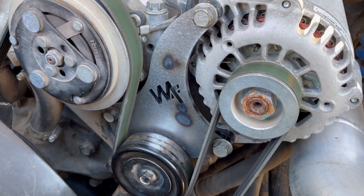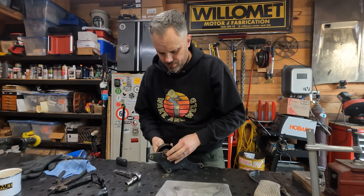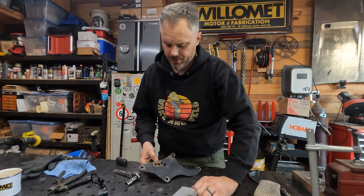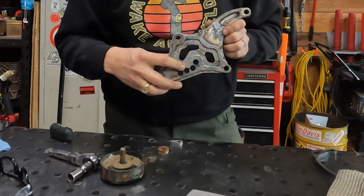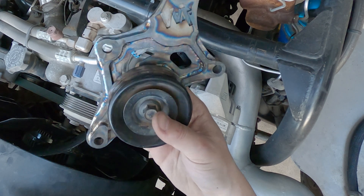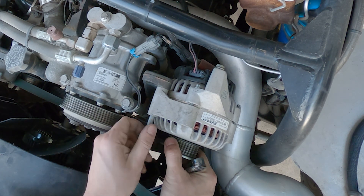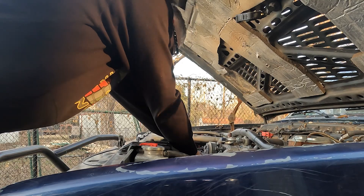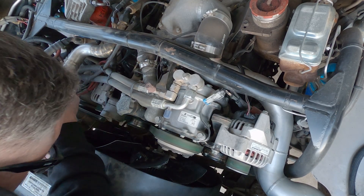I've got the jig and everything laid up so it all goes pretty efficiently. Look for these on the site — you'll be able to find them. I'm just going to transfer this pulley straight over. One of the idler positions I have on here is the original one — this second hole up is the original idler position, and that's what I'm using. It's a pretty straightforward install. It is a little different because I've already got the alternator in here, but an alternator is not hard to put in, especially if you don't have this charge tube. I've listed all the additional hardware, the idler, and the belt in the description link — all commercially available from my Amazon store or your local parts house.